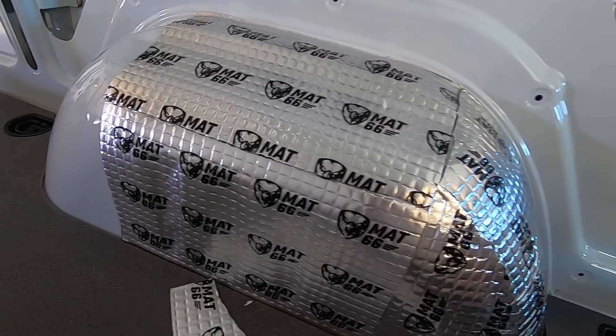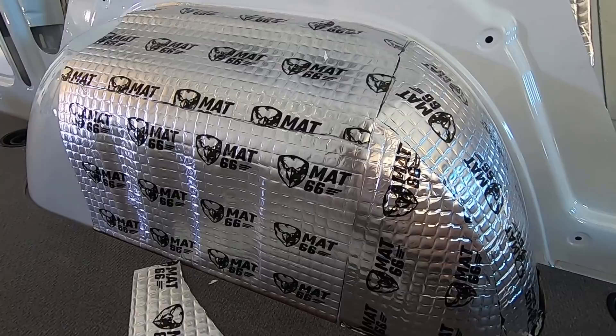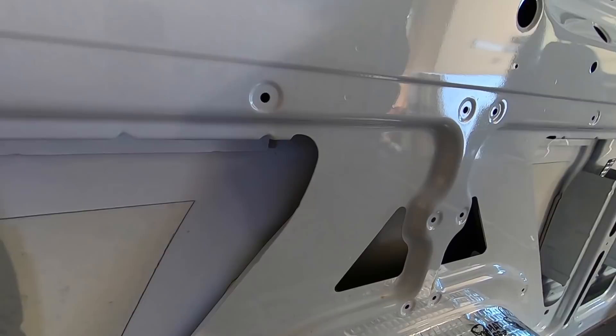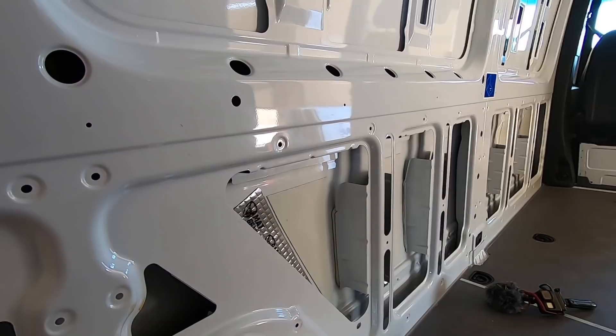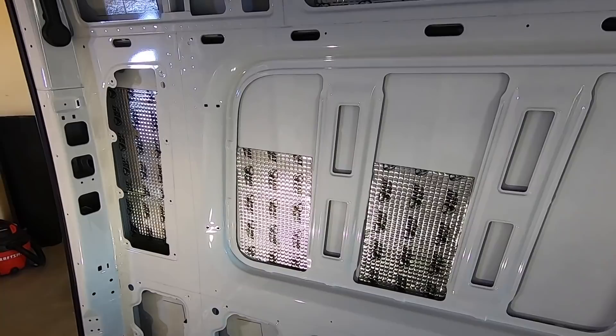It's sticking good. I'm just using the little scrap pieces. See the white stuff that was put in by the factory — I'll just go around that. One fender well done. I'll just keep cutting them and go around the factory insulation there. This thing sure rumbles when you drive it, so hopefully it helps. I'm going to run full sheets first and then when I cut I'll just put the pieces down around the other ones — that way I'm not cutting up full sheets.